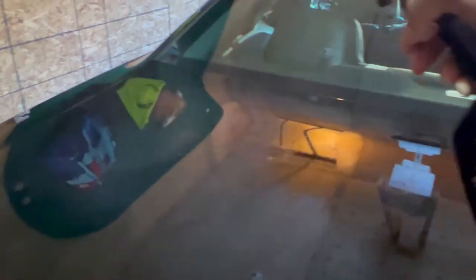Just don't put too much product — just put a little bit, just like this. Once you see that the product can spread across all the places — here I'm using the trunk — then take a microfiber cloth, make sure it is dry, and spread it across. Try to use a circular motion for the best results. You need to make sure that you wipe away all the excess material; do not leave any residue. Second thing: do not try to spray onto your glass or any plastic parts. Here you can see I'm actually being careful not to spray anywhere else but just on the metal part.